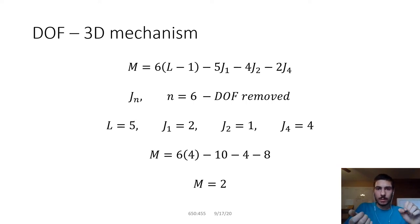Because the tie rods are also connected to the pitman arm at a wacky angle, all those motions are actually combined. They're moving along a combined axis, giving four degrees of freedom total — not just laterally and vertically, but along two combined axes in each direction. That additional combined axis is what gives it four degrees of freedom. It's a bit tricky to explain, so I hope the following videos will clear things up visually.